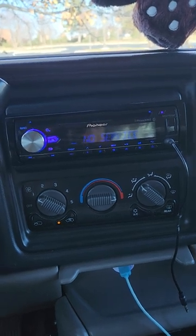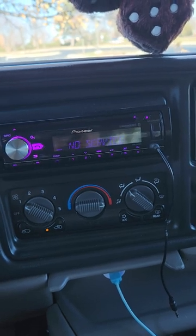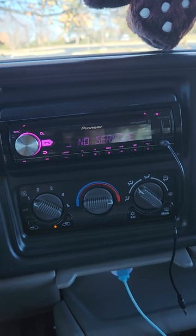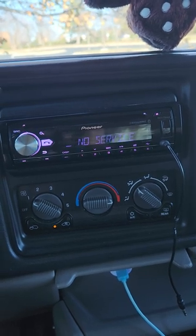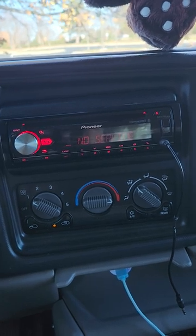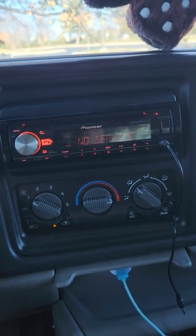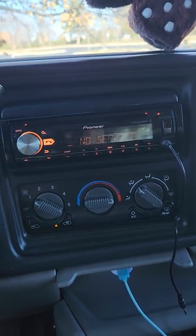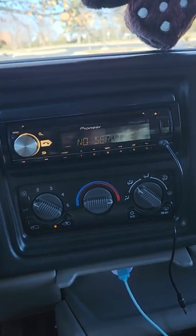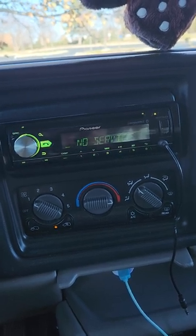Hey, what's up everybody, my name is Julian. I just want to make a really quick video discussing where to set your low-pass filter on your amp or your head unit. The answer is it's up to you, but you only want to have one filter — so pick one, either on the amp or on the head unit. If you have an amp where you can't turn off the filter, then what you do is turn it all the way up to the max. In my case it's 250 Hz for the low-pass filter on my amp — turn it all the way up and set it on the head unit.